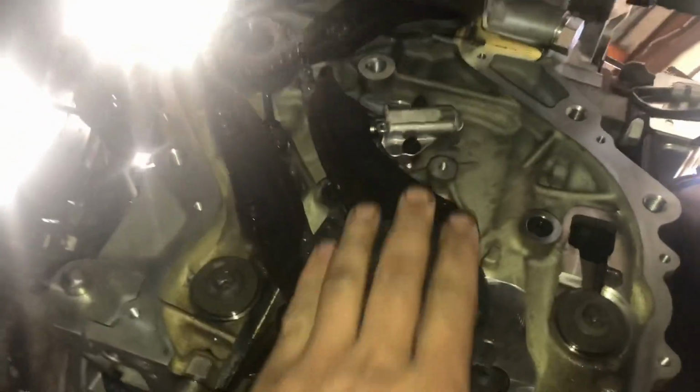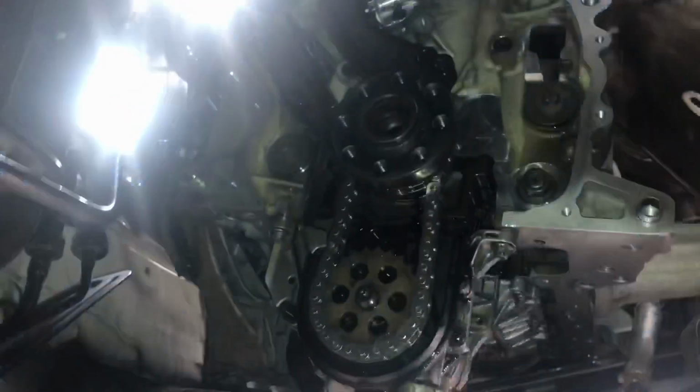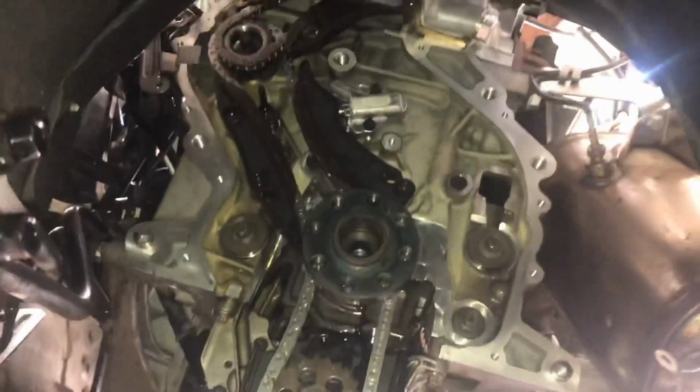Twice round, make sure your Tipex mark is back there, and then the setting bar should slot straight back into your camshafts if you've done your job right. And in this case, it's perfect. We've turned it over, we've done it twice just to be double sure, and it's absolutely fine. So that is it. It is gearbox back on, and you know, flywheel, sorry, engine plate, flywheel, all that, all going back the other way. I don't really need to show you how to do that.